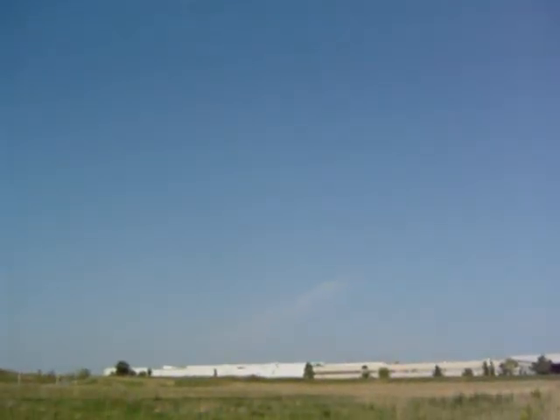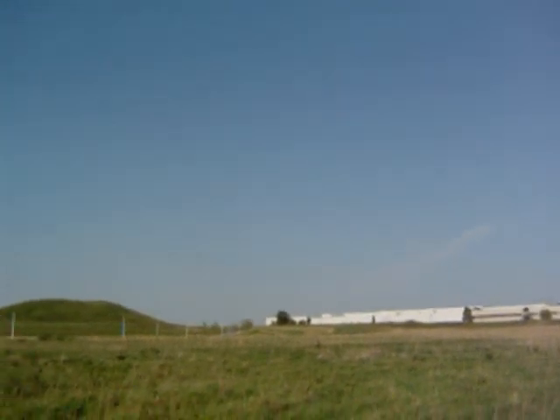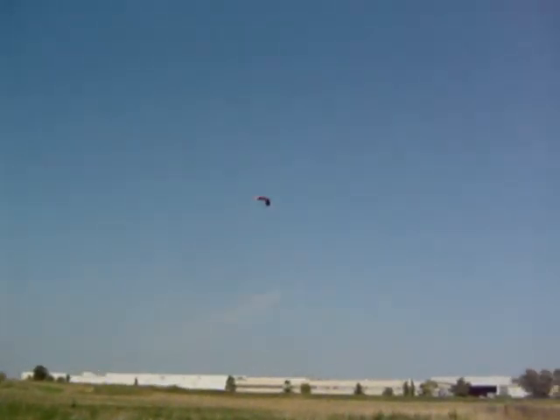I bought the Techsumo from Hobby King as an ARF, almost ready to fly. I have put an AXN motor on this with a 6x4 folding prop. I've set this up from normal, that is flat, on both the elevons, and raised it up mechanically at a quarter inch high. This is the flight characteristic that it should give you.